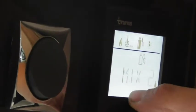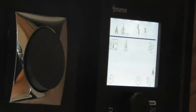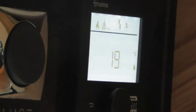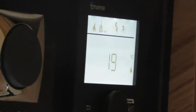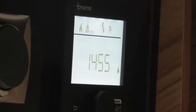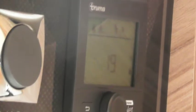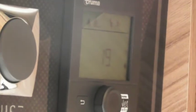Okay? Right, okay. So the reason why we may want to use a mixture of both energies, obviously, it's quite a small vehicle, 2 kilowatts, it's not a huge amount of energy. If you compare that to at home, 2 kilowatts is probably boiling the kettle, it's not heating the kitchen, right? 2 kilowatts in here in the summer is probably efficient enough to give you enough hot water and give you a bit of warmth in the room, obviously as it cools down in the evening. In the winter, it may struggle. 2 kilowatts is, as I said, not a huge amount of energy. So that's the reason why you may want to use a bit of mix.